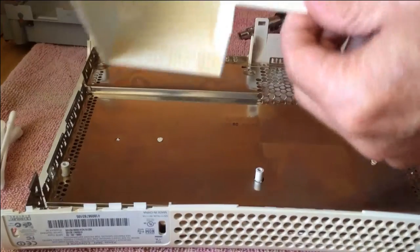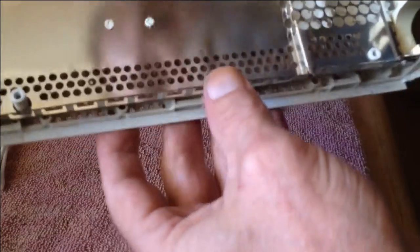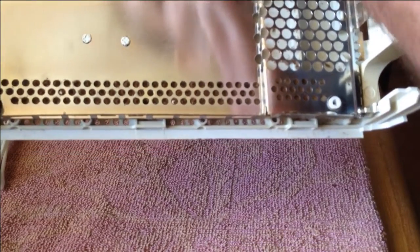Be careful when cleaning the bottom panel. The attached heat shield is only held on by plastic nubs. If you pry on the heat shield, those nubs will break, leaving you to maybe have to glue it on or something.